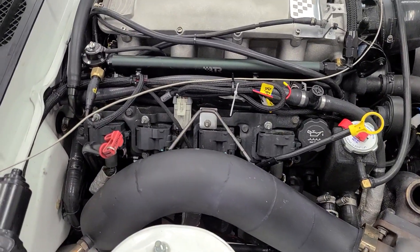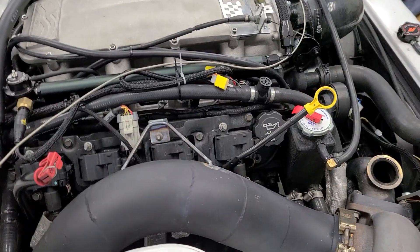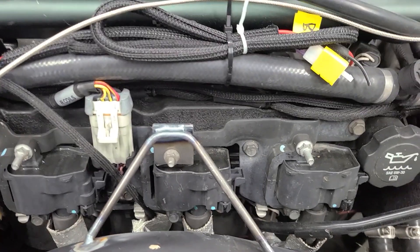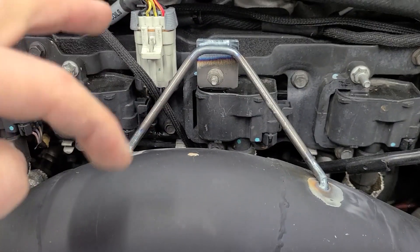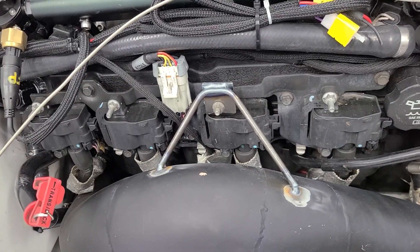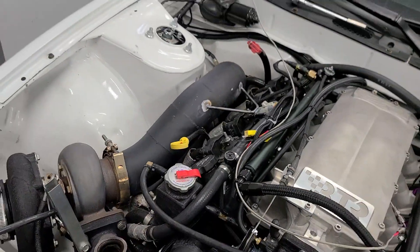Maybe as time goes on I'll start doing more and more with round rod for bracketry and stuff on this car and maybe even some of my other projects - maybe that'll be kind of my thing that I do on my cars. I got her welded in there, at least tacked in place really good with nice solid tacks everywhere. I will do a little more welding on this - I might wait until I have this downpipe out where I can access the bottom and backside better and get a really nice bead all the way around and then get a bead on the bottom side of that. But for our purposes here today and as far as removing this turbo this week, that's going to do the job and I think it looks pretty cool. So that was a win.